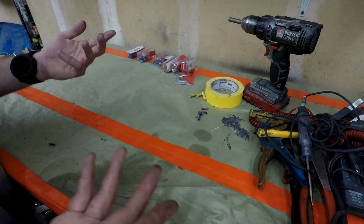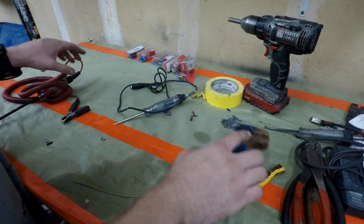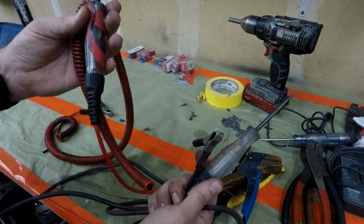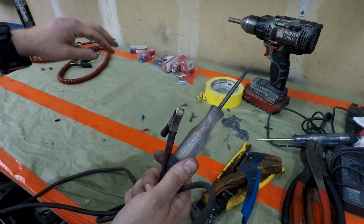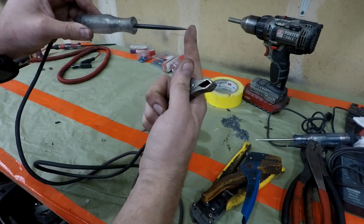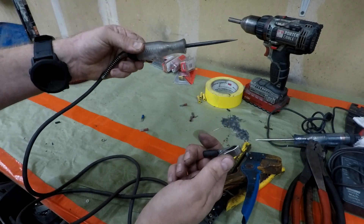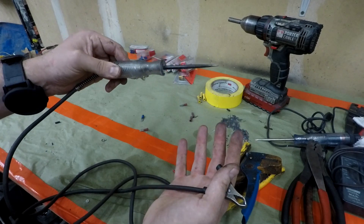You do need some tools when you start troubleshooting, but it's not really that expensive. The first thing you're going to need is a test light - varying in price from extremely cheap to stupidly overpriced. This is a Matco unit which has a very long probe on it but obstructs the light bulb for about 60% of the test light, so as far as I'm concerned, not that useful. Here's how a test light works: there's a little light bulb in it. I connect this to a ground and touch this to what should be hot. If it is indeed hot, the light bulb turns on. Connect this to a ground, touch this into where a fuse should be, and if it lights up, that means there's electricity going to it.